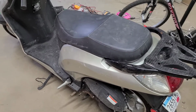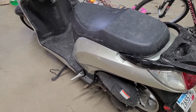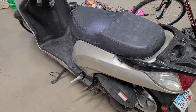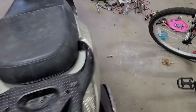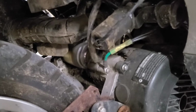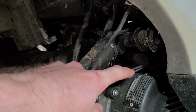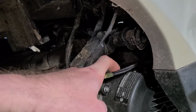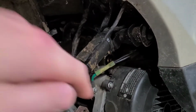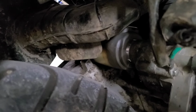which, think of the resistance created by that going through bolts, the head going to the engine block through a head gasket. So that's that wire down in here. I just ended up cutting the end off of it, splicing in a couple of extra wires just to make sure it was able to carry the amperage, and moving it back to there seems like it really helped a lot. There's a little shot of the new starter in there.